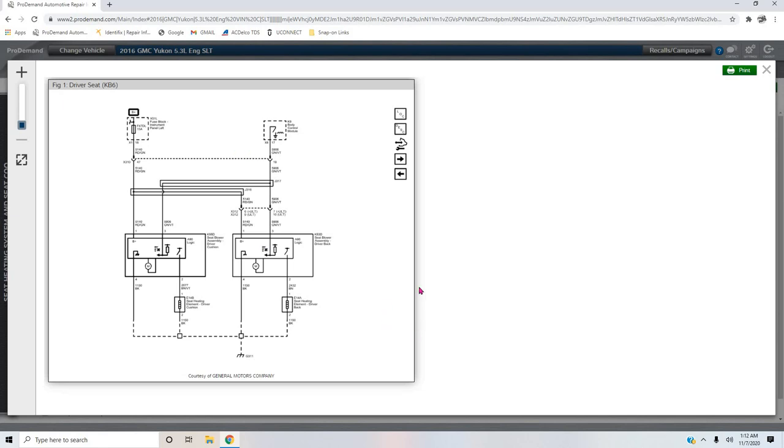It's a basic low speed CAN type communication style. And when you look at this, each blower motor assembly has the motor internal to it, so it's controlling its power and its ground based on this 12 volt feed it's getting. It's always going to get this battery positive feed. All the BCM is doing is monitoring that feed. You can see it's monitoring that battery positive feed, both on this side and on this side. And it's also monitoring the internal 12 volt regulator, I would imagine, inside the actual blower motor assembly.